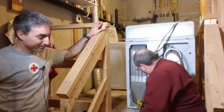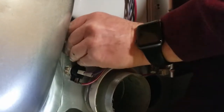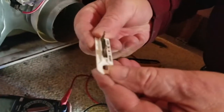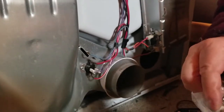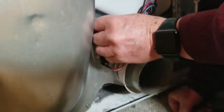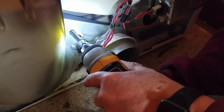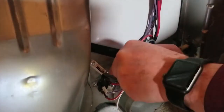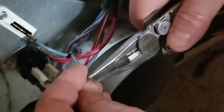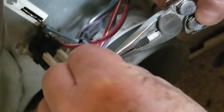So we definitely want to check and clean out the dryer vent — since we're touching this, we're going to clean it anyway, but that may have been our root cause. We'll start by replacing that fuse and then clean up the dryer duct. The thermal fuse on this particular model fastens with one screw — pretty simple device. It looks like this connector got a little sloppy from cycling, so we'll give it a very gentle pinch so those loops grab onto the spade a little bit tighter.